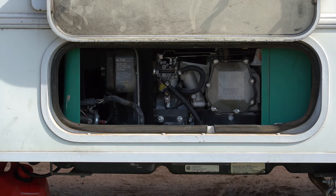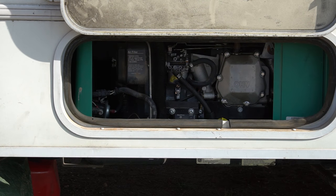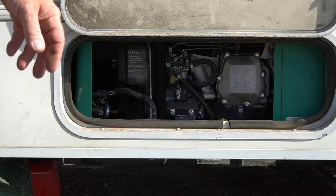We're going to let the generator run for about 30 minutes on that fuel, then stop it. I've run it for about 30 minutes and now I'm going to let it sit for 30 minutes, then run it some more. That's going to allow the fuel cleaner to soak in the bowl and eat out some of the buildup. Now that we're sure we've got all the other gasoline out and just the treated fuel in there, I'm going to let it sit for about 30 minutes and come back to run the rest of the gasoline out.